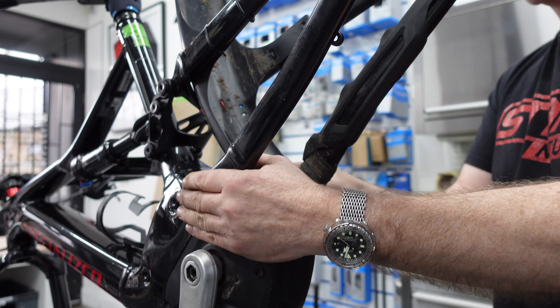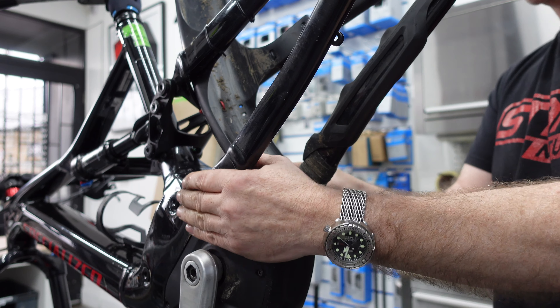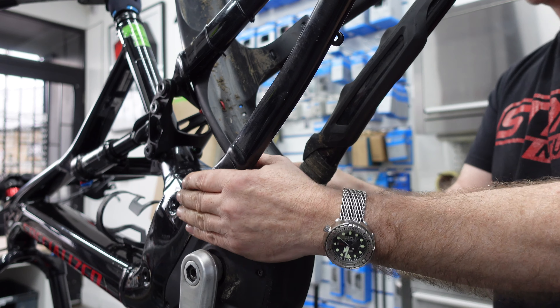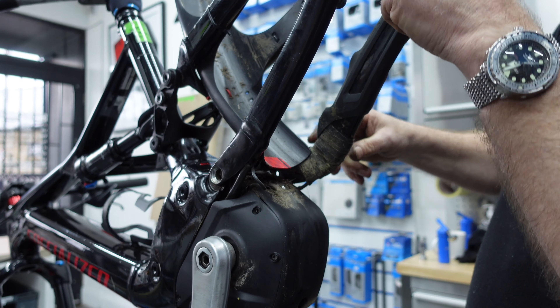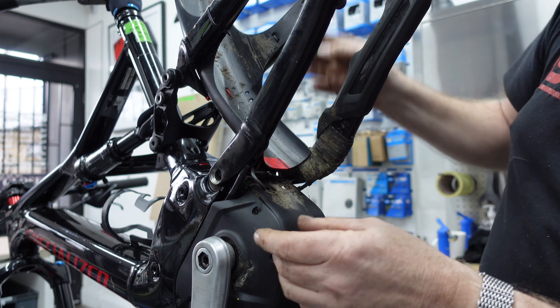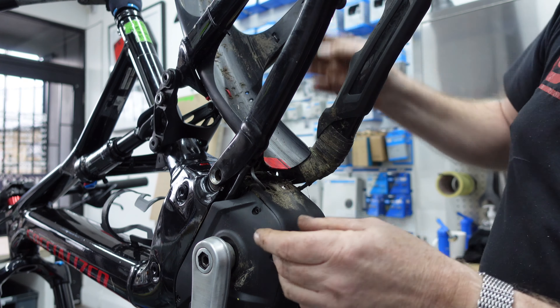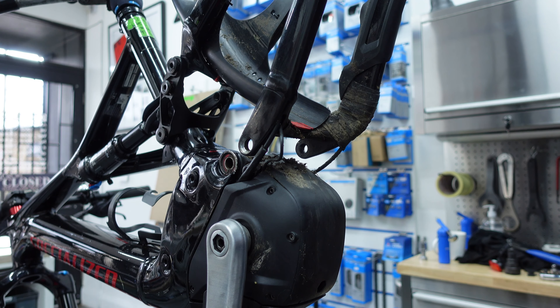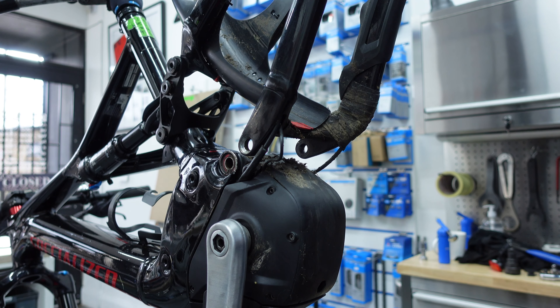I've created a little bit of space and maneuverability with the magnet sensor wire on the back, and loosened this hose to give us more room. We just need to carefully pull this out to one side, just enough to get to the bearings. If you still can't get enough room after loosening the hose, then you need to take the caliper off — that will allow more space to get the bearings out.